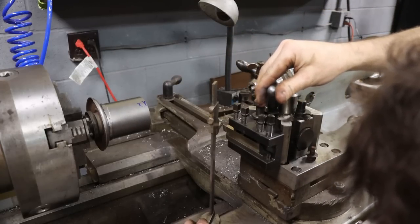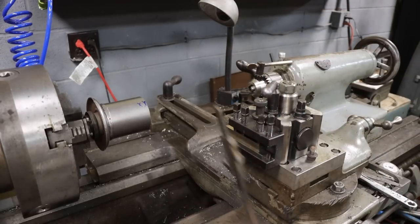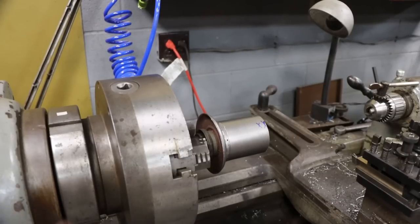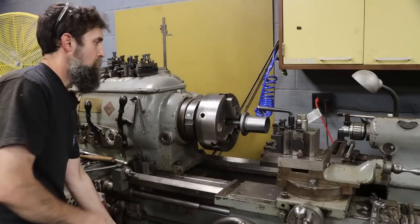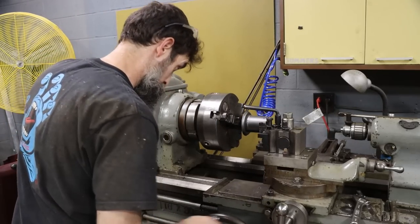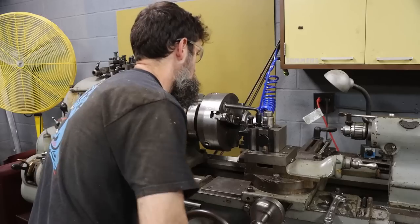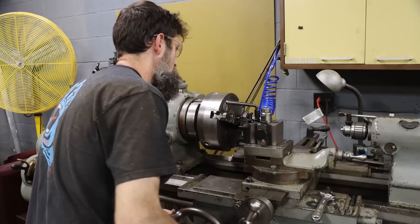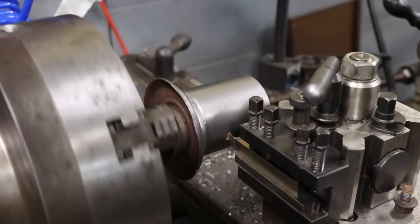If I could have pushed the engine forward farther, but there were some interference issues between the oil pan and the steering linkage on that C30. So I just decided to put the motor in the original position, use the original holes that the transmission crossmember and stuff come out of, and just decided, hey, shortening a drive shaft's not all that hard.